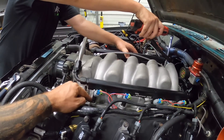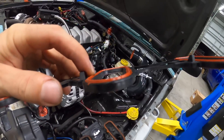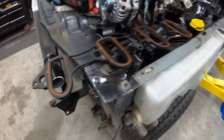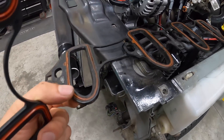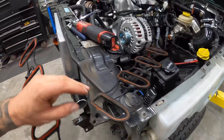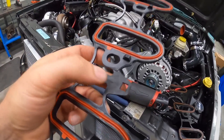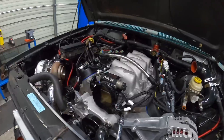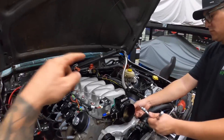I'm new to the Chevy world but check out the new Felpro gaskets — look at the lip on them compared to the ones that came out, which are completely pancaked. Exact same gasket, completely different. That one was definitely not sealing well. We did have to trim off a couple of tabs on the ends so they'd fit this manifold, but they look like they'll work. Let's get that old crushed gasket out of there.